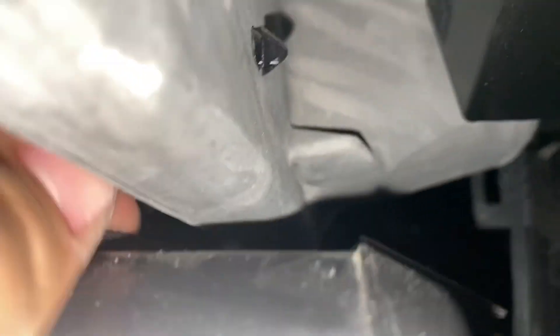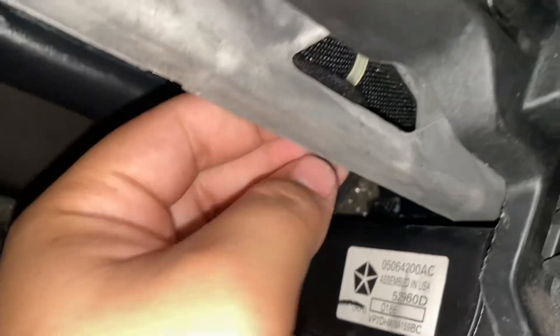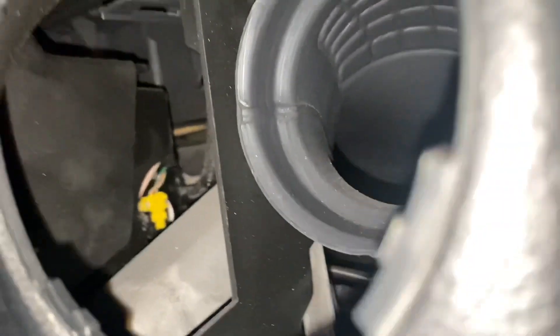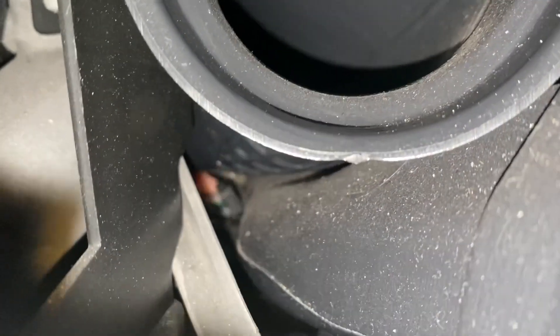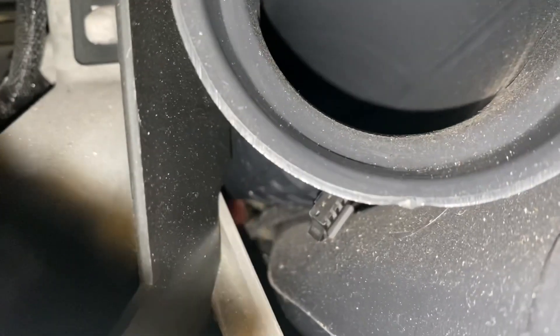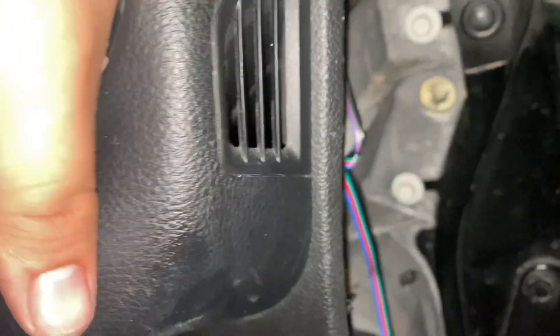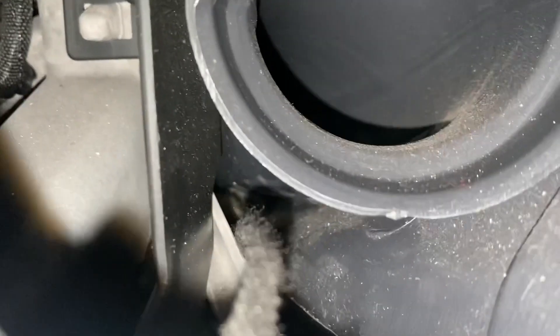You'll probably be able to see the AC vent. You see this little hole — you see my finger? You could run it through that corner over there but it's a little tougher and you're getting close to the airbag, so I'm going to avoid that and go underneath. You've got to fish it and play with it. Just like that — you're following the AC tunnel or compartment. You can't even see it now. I'm just going to organize it and zip tie it so it doesn't get in the way.